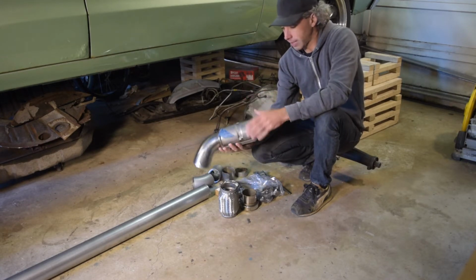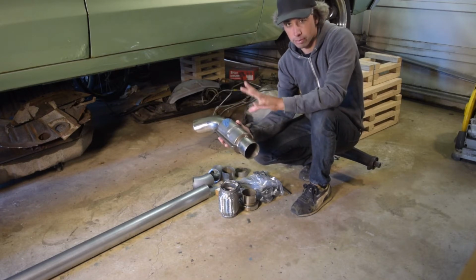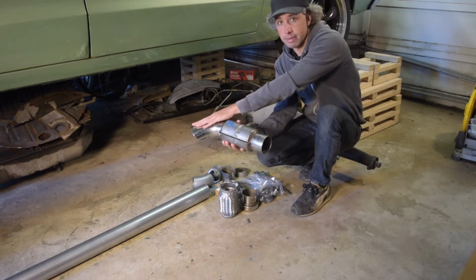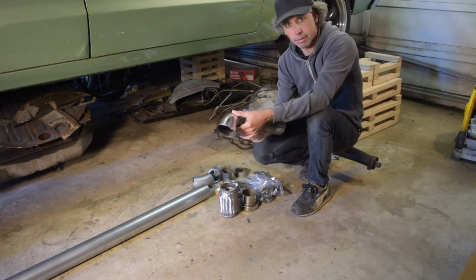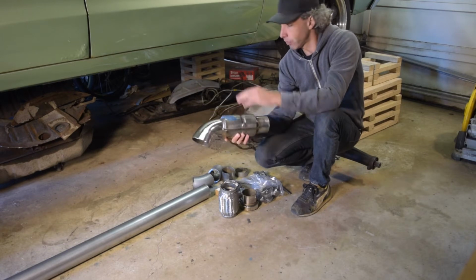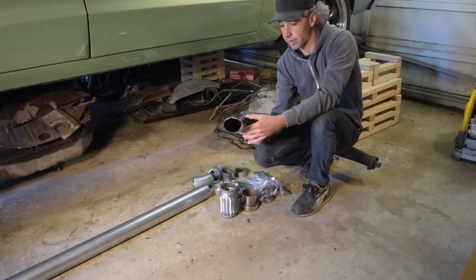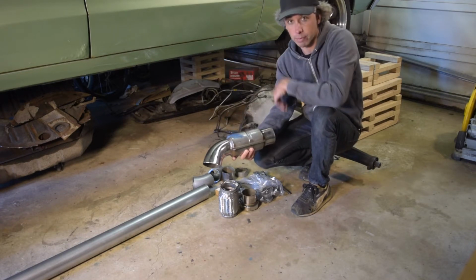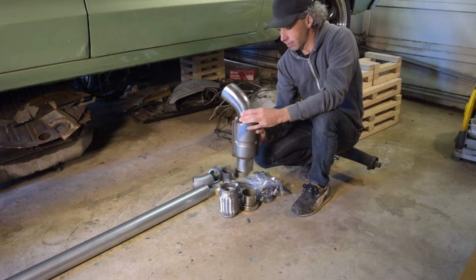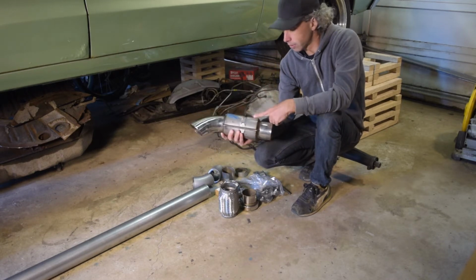It's a 3-inch performance cat. This is designed to basically go right out the back of a 911. If you're familiar with Porsche and how their engines are set up, this would basically just be sitting right under the rear bumper. And this is kind of like a flattened 3-inch exhaust. So what I'm going to do is actually just cut it off right here. I'll be reusing the cat forward in my exhaust system up here, and then I'll probably just reuse this tip. This is a nice stainless tip, and we're just going to put it right out the back on the side. So 2-for-1 for me. I get a stainless flattened tip and a super high flow cat that's been used once just as a test fit. So super cool, pretty excited about this.